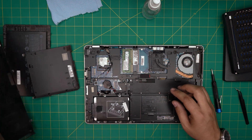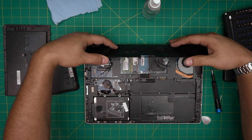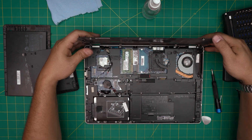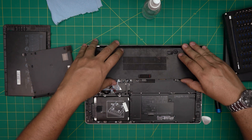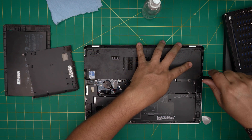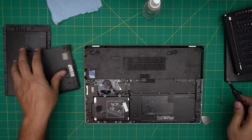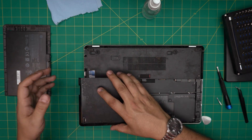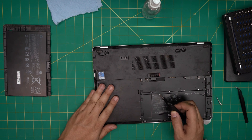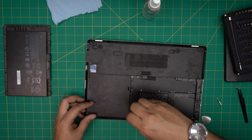Once the hard drive is done, if you cleaned the bottom cover let it dry then set it down on the back side — like folding a book — with the hinges aligned. There may be one or two broken hinges over time. Close the lid straight down and tighten up the captive screws. For the side service cover, it goes on in an offset position — slide it in rather than placing it straight on.